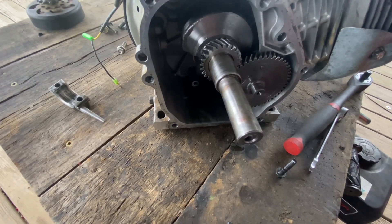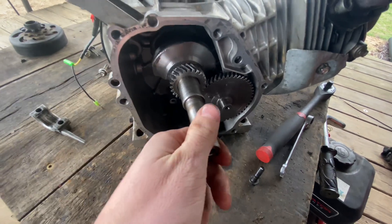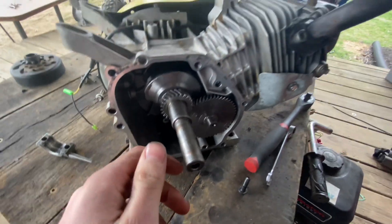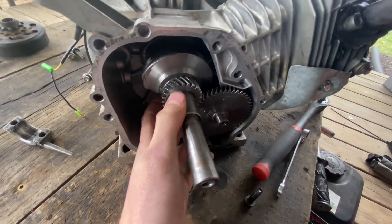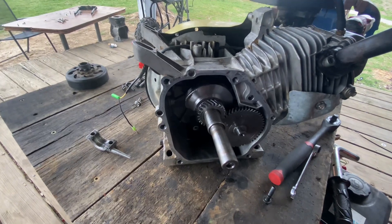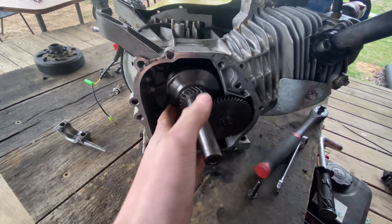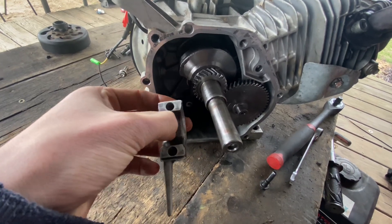As I was going down the road at high RPM, the cam advanced timing and it started to run bad — it didn't want to open up fully, just sluggish. I thought it might be the valves, but it wasn't. I rode it thinking it might work itself out. There was smoke that could have been a head gasket, but the head gasket was fine. I adjusted the valves, got it running, started it up and heard a big knock. I tore everything down — head off, everything off — and noticed the rod was moving but the piston wasn't. I figured it was either the wrist pin, the rod bearing, or the cap. I popped it off and found this damage. The top of the rod looks scored and the crank is starting to look the same — this is no good to run as-is.